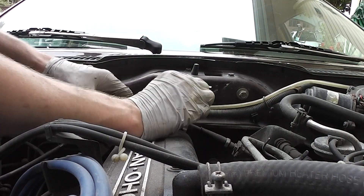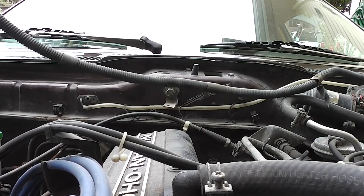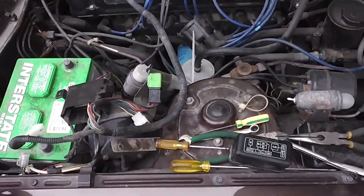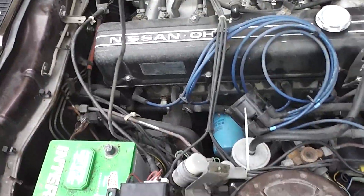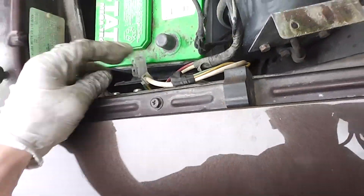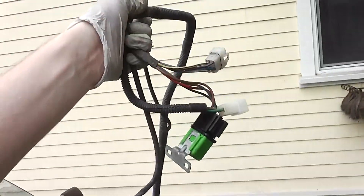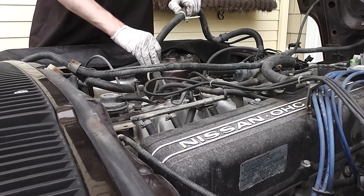Okay, separate some stuff here. It's definitely going to take a bit of fishing to get all this out, but it should be fine. One thing I forgot to mention is I had to remove this insert from the fusible link box in order to free everything else. It's definitely very tricky to notice, but that does have to be done. It's either that or fishing through the firewall and through the body harness to get all this stuff disconnected, which is just unnecessary. But now we're officially free on the passenger side of the engine bay, and I think now we're going to take the whole thing out — ancient EFI is coming out of the car.